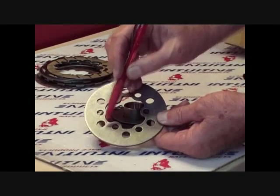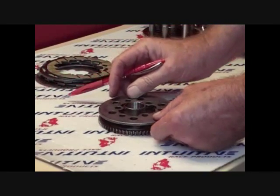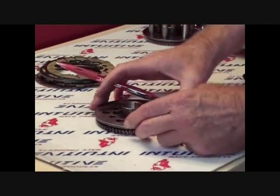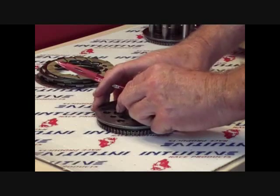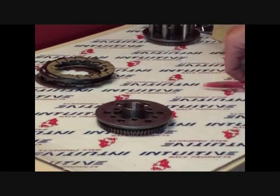If you replace your OEM fit bolts with new OEM fit bolts, just make sure that if you use the longer OEM fit bolt, your counterbore is faced up. Otherwise, the shorter fit bolt will work on any model as long as the flat side is up.